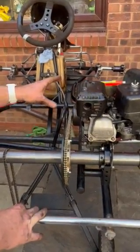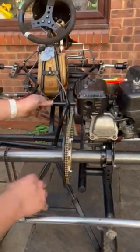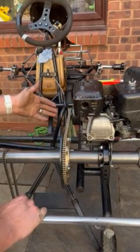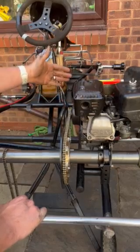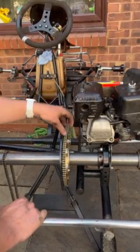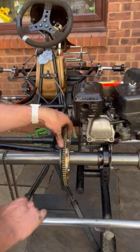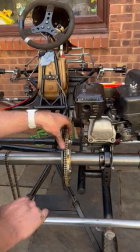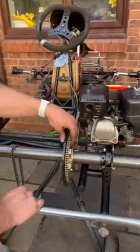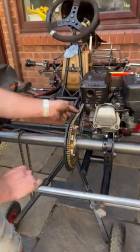In hindsight, looking at this one, because we put a 112 chain on, we would probably put either a 116 chain on, which would give us more slack and more ability to move the engine forwards. We're actually on a 20 clutch and an 80 rear sprocket, which are probably the largest ones you'll ever use in the GX series. A smaller sprocket with less teeth would give us more slack in the chain.